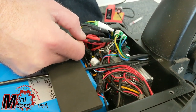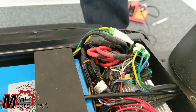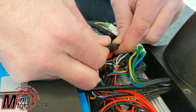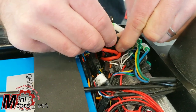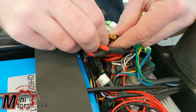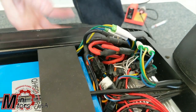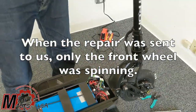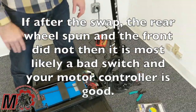We got rid of the heat shrink tubes. Make sure your scooter is off at the circuit breaker switch first, then drain any excess power by hitting the power button on the throttle assembly. We switch the positives and the negatives, then fire it back up — and we're having the same issue. So it's not your switch; this leads me to believe it is going to be a motor controller for sure. If it had been a bad switch, your back wheel would have been spinning and your front wheel wouldn't. So we can rule out — the switch is good.